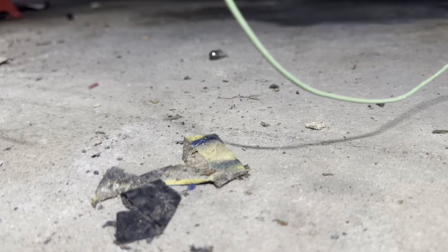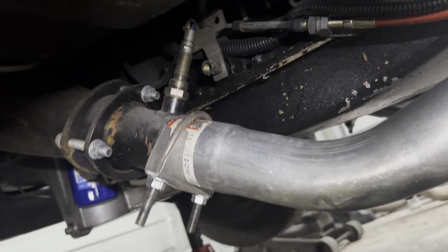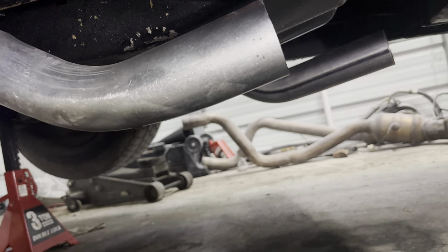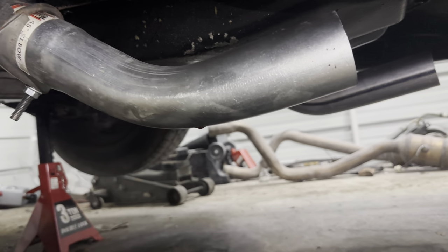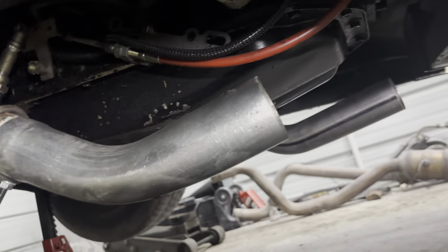I went ahead and jacked the car up just enough to get under here to where my muffler setup is. So I've got shorty headers on this thing. I had some cheap little muffler clamps and I took that and got a 45-degree elbow for both sides. I've got a 45-degree elbow over there — that one's a little bit longer, they're two different ones. My plan is to see if I can bolt this 2.5-inch elbow to those 2.5-inch mufflers.